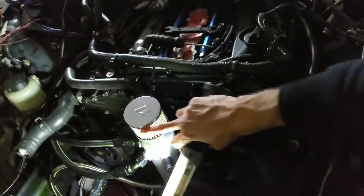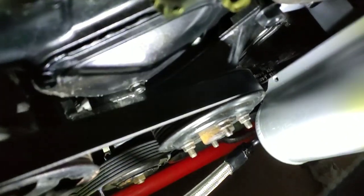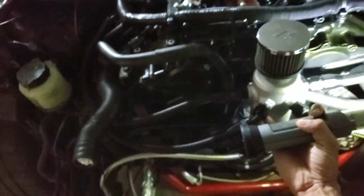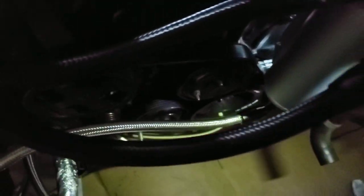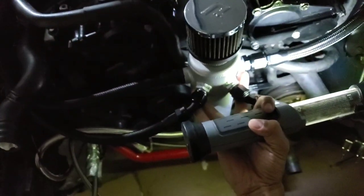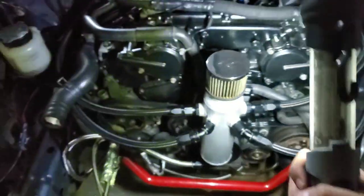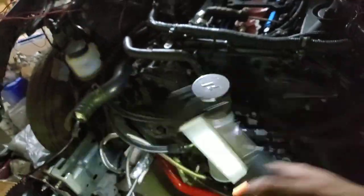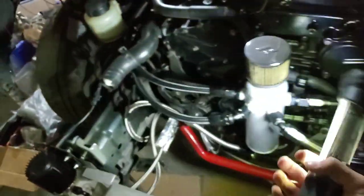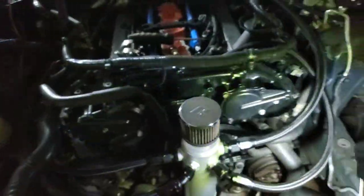The catch can is done but mounting is going to be tricky. There's hood clearance to worry about and the can is literally sitting on the pulley right now, so it needs to be mounted higher while still clearing the belt. Also have to watch the rad support when that side goes on to make sure nothing is hitting the lines. The line lengths are pretty much fixed so there's only a small range of locations where it can realistically be positioned.